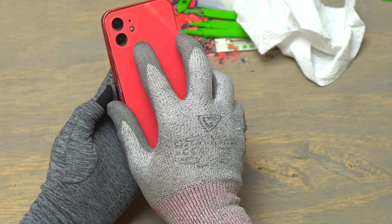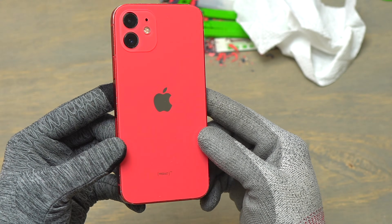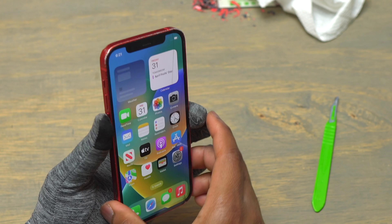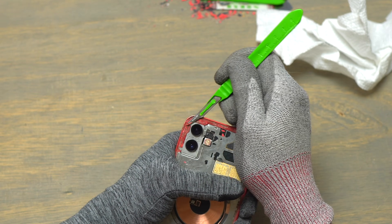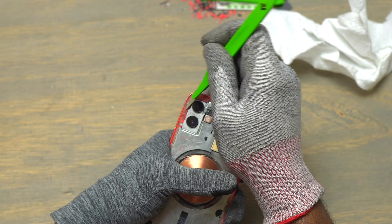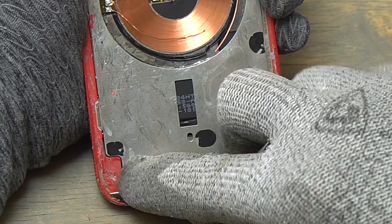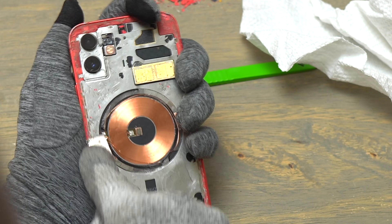Currently, I'm trying to fit the glass on the back of the device after all this work. I haven't done the cleaning yet. After removing all the glass, you need to clean everything. Despite all the heat, the wireless charging coil and cameras are still working — no blurry situation on the cameras. To do the cleaning, remove all the double-sided tape still on the back by scratching the surface. Without cleaning the back of the device, you risk cracking the new glass during installation, or the glass won't stick for long. If you do not clean, you will have to redo all of this.